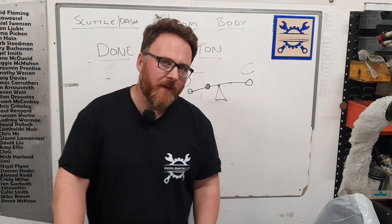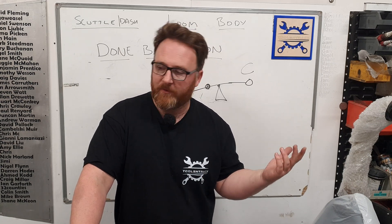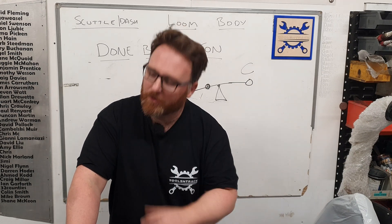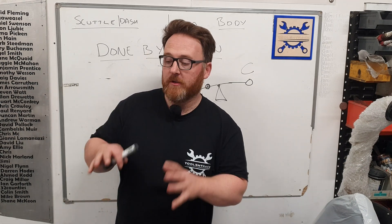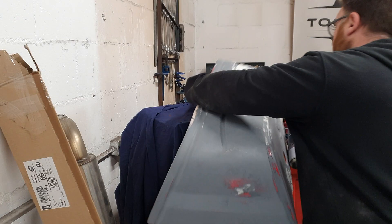It's still quite heavy and I think it's possibly because I'm using a Land Rover master cylinder with an MX-5 slave cylinder. This is obviously going to be a problem and we may look into it in further depth if it gets to really problematic areas, but for now it actually works. So we're going to roll with it and carry on — and by carry on, I mean make proper progress. Let's finish this. Let's do this.